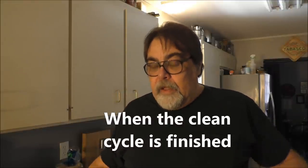You can't open it until the oven gets below a certain temperature, because in clean mode they get up around 800 degrees. That hot blast of air coming out is not good for you — it can damage your eyes. Matter of fact, my great-grandfather was a baker and he went blind from that, working in a bakery long ago — the hot blast of air hitting him in the eyes when he'd open the oven. The way that one worked was it locks the door and cycles the bake and broil elements on and off constantly, holding it at around 750 to 800 degrees.